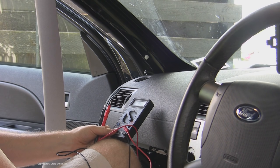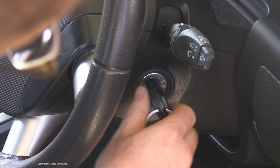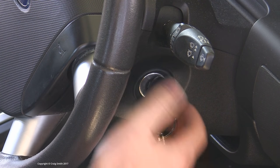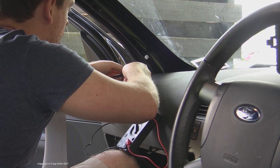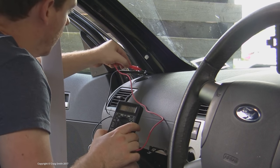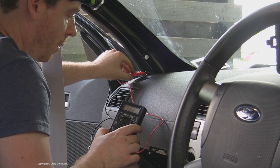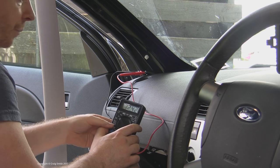You should stop again and check the voltage at this point — with the ignition at the correct position. You'll have to use position 2 if you're not using the accessory circuit like me. Just stick the voltmeter in the plug or wires and confirm that you're getting 12 volts like you expect. This will check everything upstream: the fuse tap, the ground connection, and the wiring all together.